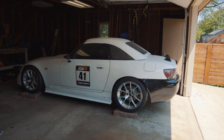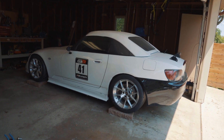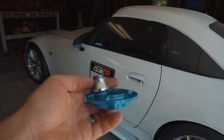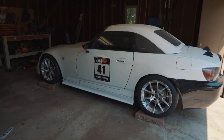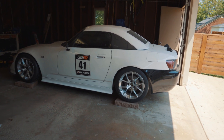It's the next day, and I spent a little time yesterday dialing in the ride height, and I've got it where I wanted. For the fronts, I actually ended up getting some different top hats that are a little bit slimmer than the ones I had on the suspension originally, and the spacer as well was a little bit slimmed down. That ended up giving me the clearance I needed to clear the upper control arm, as well as the fact that I adjusted the ride height and raised it up a little bit. So I'm really happy with the fronts.